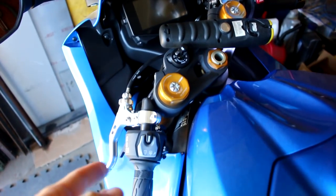I'm going to show you how we're going to put coolant in there, because you would think there's no way to get coolant in there. Well, I'm going to show you a little trick. So you remember we talked about this spray bottle — a little spray bottle tested at the kitchen sink just to make sure it works. Now all we're going to do is take the X-Star Super Long Life Coolant and fill this bottle about halfway — we're not going to need that much to top off the coolant on the motorcycle.